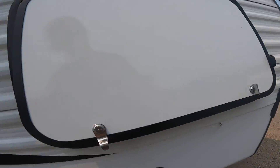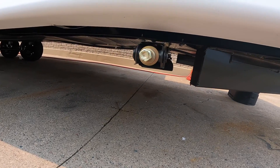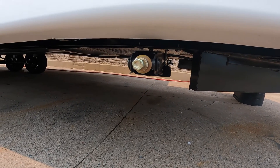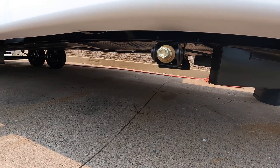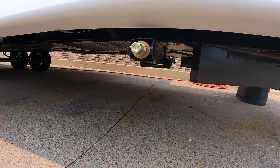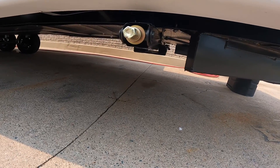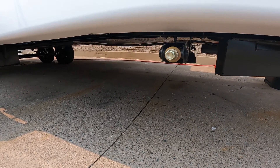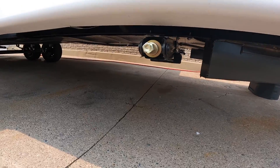Taking a closer look at the stabilization jacks — there are four of them at the four corners of the RV. They should never be used to level your RV; they should only be used to stabilize. Once you have your RV mostly level, you snug these up to the ground or any blocking you may have. It's recommended to have blocking on hand depending on your campsite, as the jacks may not reach the ground. Six-by-sixes are recommended and usually work well.